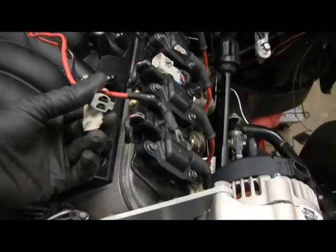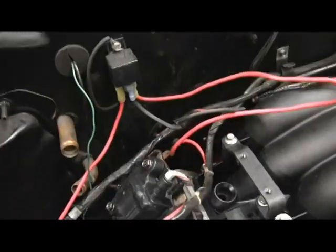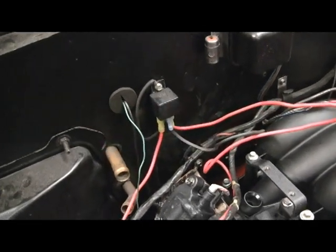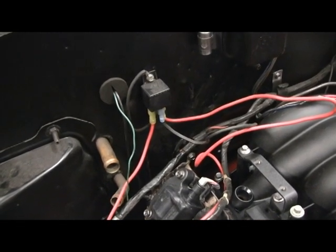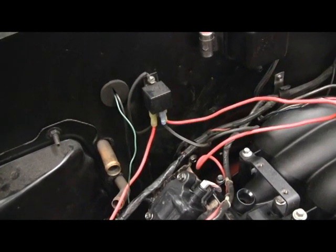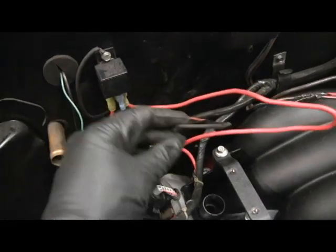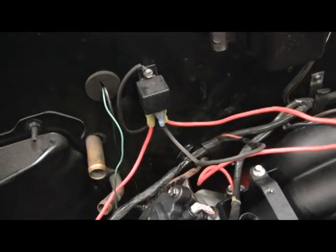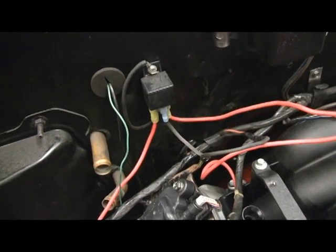This went to the old alternator, which was a two-wire alternator — that's the plug for it. And then this is to the battery, essentially. This little solenoid here I added a long time ago when I put HEI ignition on the small block. HEI ignition needs to have a full 12 volts. If you just run a coil wire to it from an old distributor, it's really not 12 volts and it doesn't work well. So what I did years ago was add the solenoid. The wire that went to the old non-HEI distributor runs up through the solenoid — that's hooked to the key — to basically turn it on and off at full 12 volts.